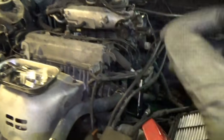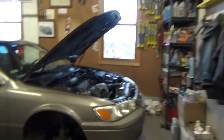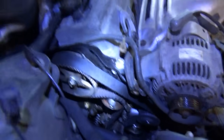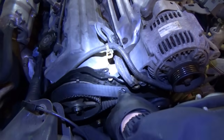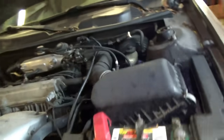So we're pretty much done on this side. Let's move on to the timing belt. Back to the Toyota Camry — I'm on the final repairs here. We've got the timing belt cover off, piece of cake. We want to see if this loose timing belt is causing a noise. If it was hitting the cover the noise should go away, so let's fire it up, rev it up, and see where the noise is coming from.